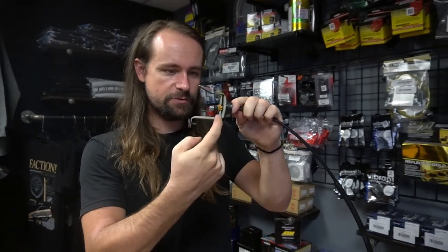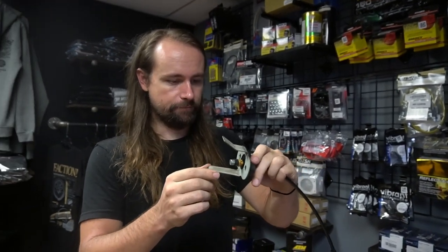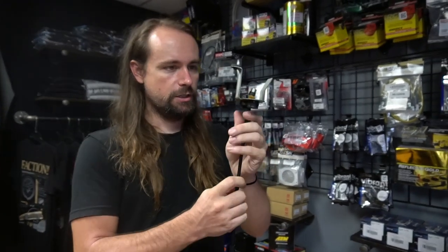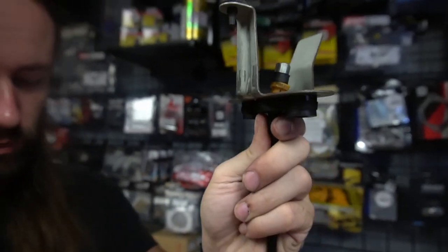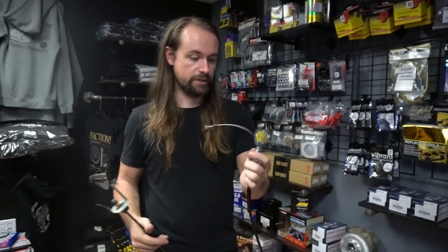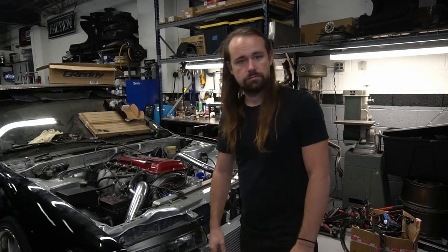The black car we saw — other than the height difference between OEM and aftermarket cables, which is about a quarter inch — his was way off. He was using a stock SR20 throttle cable bracket with a 240SX dual overhead cam throttle cable, which made no sense. We took this piece off and realized it was bent. That can happen from anything — someone bending it before installing or someone kicking it. You want to make sure this piece is 90 degrees straight up; if it's bent any which way, this throttle cable bracket probably won't work. Make sure it's good to go before you install this.